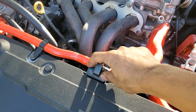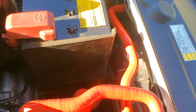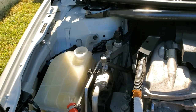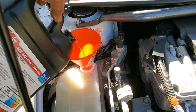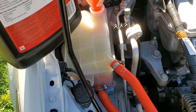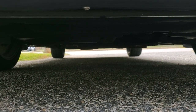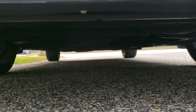At this point, pop the plastic back into place, then reinstall the battery, and connect the positive cable first, and then the negative. Go ahead and reach down and close off the petcock valve, and then we're going to start refilling the overflow reservoir tank until it's at the full mark. Check under the car for any leaks, and clean up any coolant that's spilled immediately with newspaper and cat litter — and anything you can't soak up, wash away. You don't want to leave any fluid on the ground for any domestic or wildlife to drink.